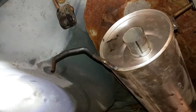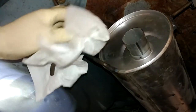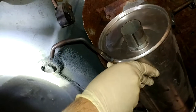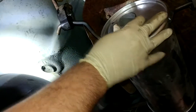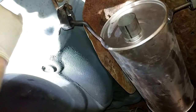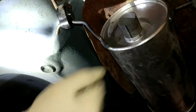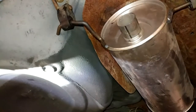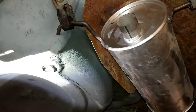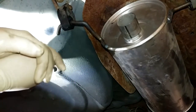I'm putting some disc brake grease on there trying to cool this down — it doesn't really work but it makes me feel like I'm doing something. That is down to a temperature where the exhaust would probably normally operate. Let's see if she'll scrooge on in. Oh, there we go. I had to bend that like three or four inches — it doesn't look like a big deal, and it isn't if you have the right tools, which I just barely did. But it's a big problem if you're a 20 year old kid in your driveway at home without any of this crap. Guess how I learned all this — I was once a 20 year old kid in my driveway at home. Heed my advice: this stuff never fits right. This is one of the better fitting aftermarket systems I've seen, but don't expect anything to be a bolt-on because it almost never is.